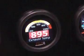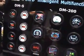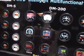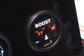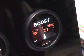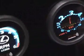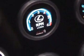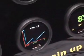Panning over to the right of our display, this is our DM200 product line. The only difference between the DM200 and the DM100 is the size of the gauge — the DM200 is a 60mm gauge whereas the DM100 is a 52mm gauge. Everything else is exactly the same, giving you the flexibility to customize your dash any way you want. This is what's unique about the PLX product line and what we think is going to be the future for custom cars.